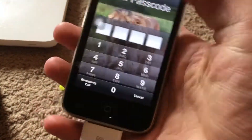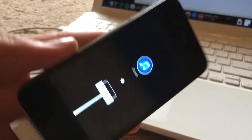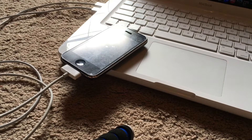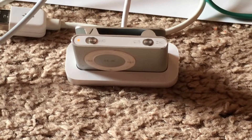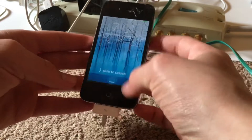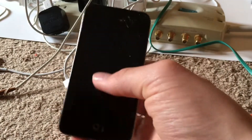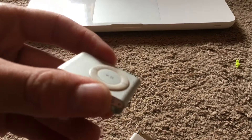This 3GS just booted with a passcode and the power button doesn't work. It did not restore - it probably has a bad baseband since it jumped right back into recovery. That's fine though. I'm restoring the 32-gigabyte iPhone 3GS. I plugged the iPod shuffle second generation into my charging dock and the orange light is on, indicating it's charging. The boot-looping iPhone 4 or 4S finally did boot and has a passcode on it. The battery is completely dead and swollen, so it will need a new battery.